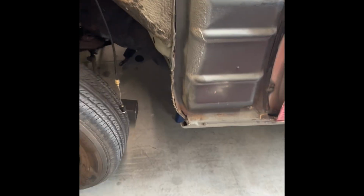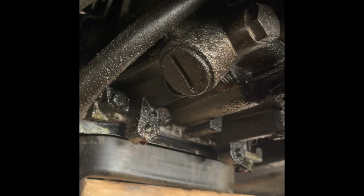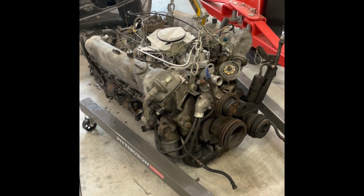But I did have to get it off the lift so I can get the transmission support freed up. Again, with my broken transmission jack, everything has to be done here on the ground. So, yeah, this was a good time. The left side of the engine has the speedometer cable, the 4-pin connector to the transmission, and the right side of it had the vacuum line.